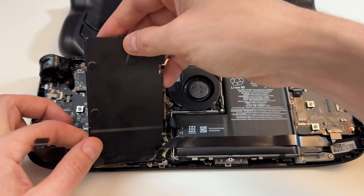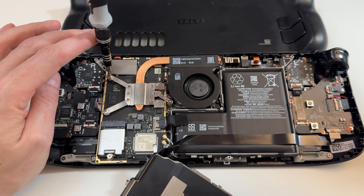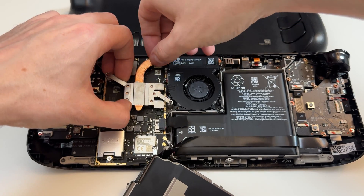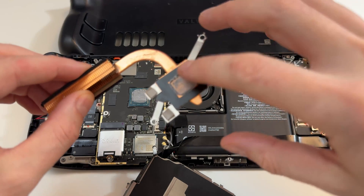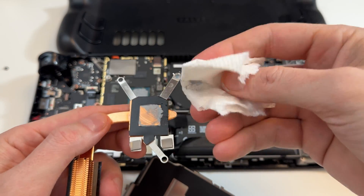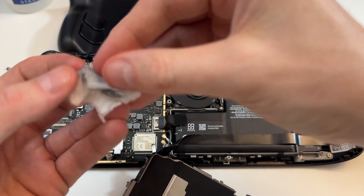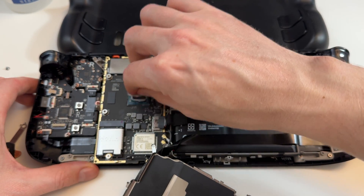So same idea — use your stars here. In theory I think this just comes off, so I don't have to pull up the whole fan — that's nice. So that just sits in front of the fan, and that is thermal paste, that is not a PTM pad. On this OLED version here, the temperatures aren't that bad in the first place. So I'm using some isopropyl alcohol to take that off — it is a paste. It looks like it was very well pasted. They did not do a bad job of thermal pasting it — there's not missing parts. It seems like Valve has a good attention to detail, which has kind of persisted.